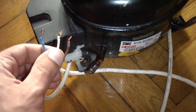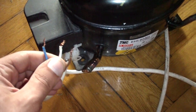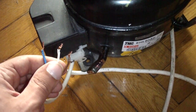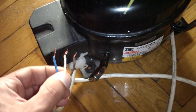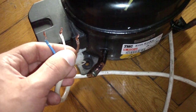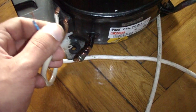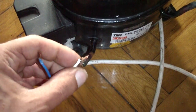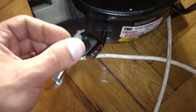It's not only used to switch the compressor on when the temperature increases, but also to power probably the light in the fridge. I checked the color coding on the internet and I guess I have to connect the brown one — that's line. This one is neutral, and here we have white. I realized that in order to switch the compressor on and to close the circuit, I have to connect the two wires.